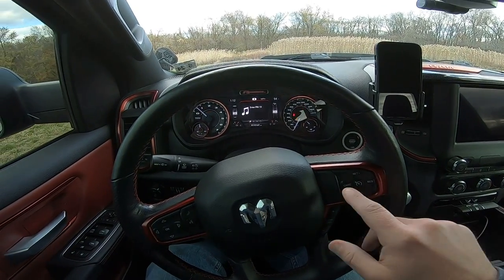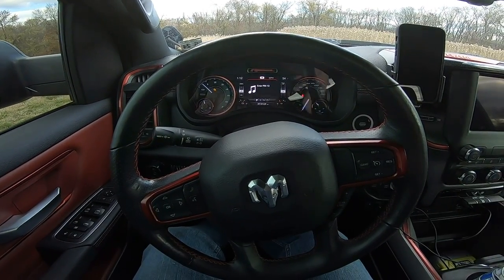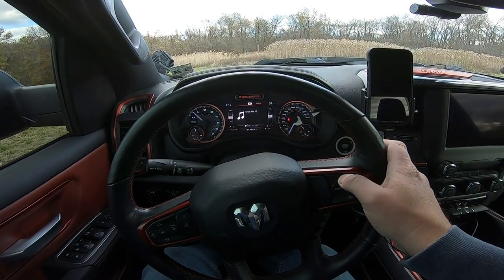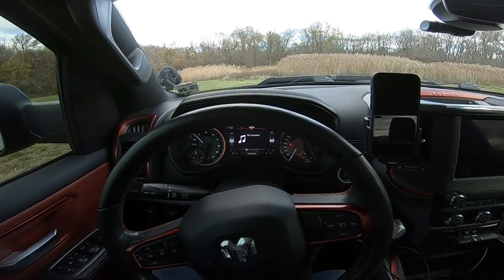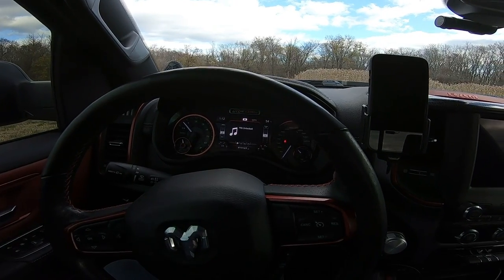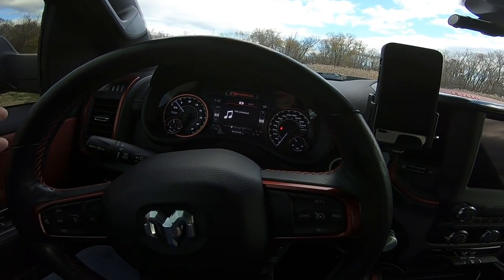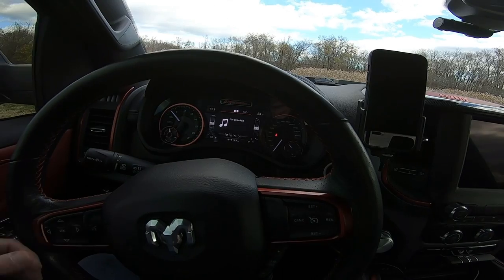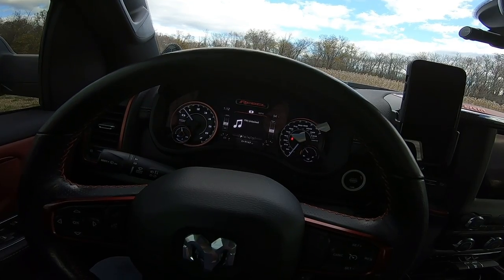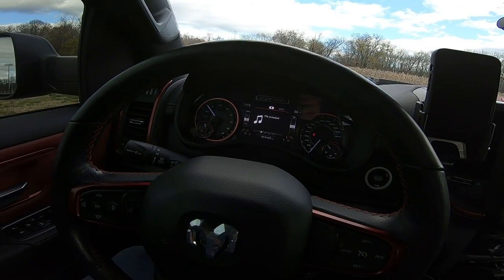I can't drive the vehicle. I have to enter the pin code to move it, but meanwhile somebody jumped in the car, they're trying to take it, the lights are flashing drawing attention. Now this is also referred to as the carjacking mode. So if you get pulled out of the vehicle and somebody jumps in, it's going to allow them to leave so you can get to safety, and after that timer counts down to zero it's still going to allow them to drive until it's safe to engage the brakes. What Zio Automotive has done is they wait until the car gets down to about five miles per hour, locks up the brakes, turns on all the flashers, and they can't go anywhere. And of course you are now 30 seconds in the other direction so you can get to safety.